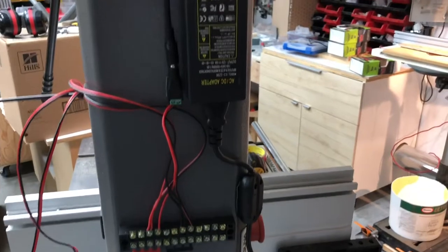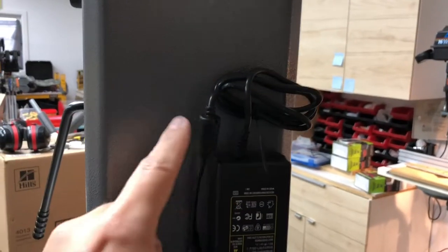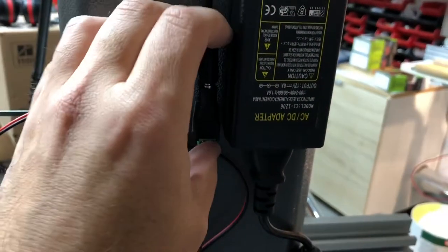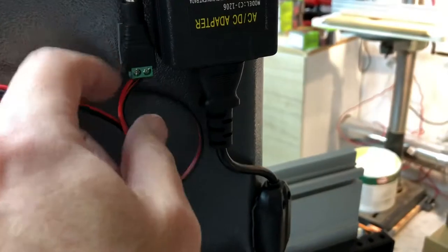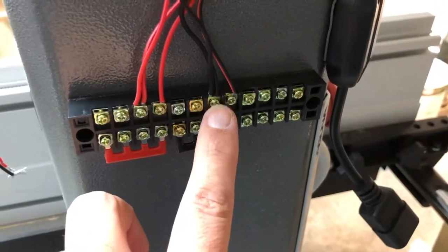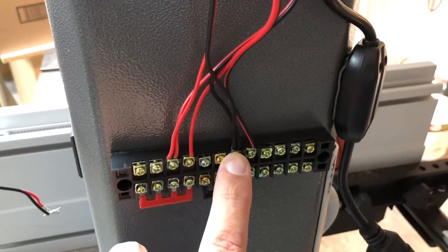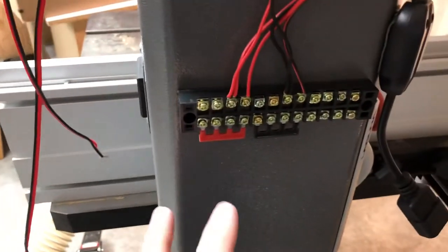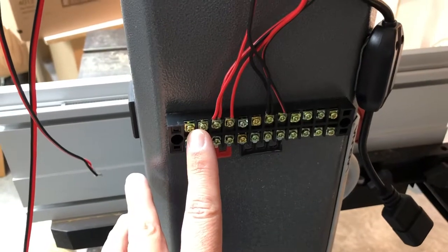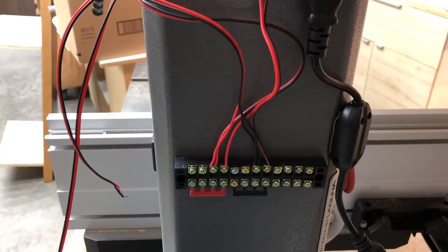Just a quick check here. I bundled up the wire and connected it to a quick connect, held in place by a little bit of that 3M tape just to keep it from moving around. The terminals are done - we have black and black, red and red. So these two terminals are for the undermount lights. I'm gonna start with two and see how that works. The other ones are just gonna sit here and now I'm gonna work on the big wire going up to the spotlight.